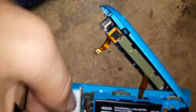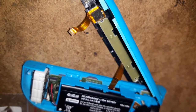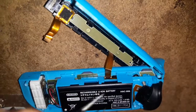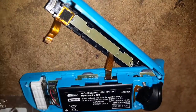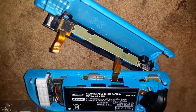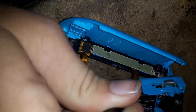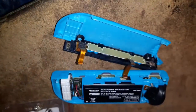Now you want to move to the back here. For this one, the plastic piece is actually in the front. Some people find it easier to remove the battery — disconnect it and take out three screws. I'm just going to ignore that and just pop that up. Just like that. Easy. This one, instead of pulling straight out, you actually have to lift it up and pull it out. Simple, easy, off.